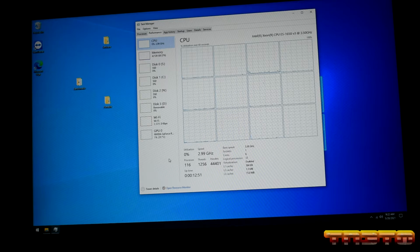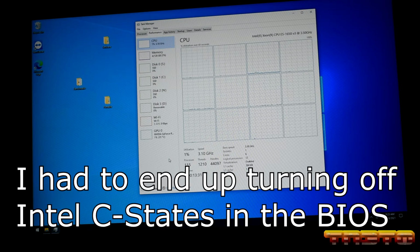Now this is a weird thing, because I went into the power options and set it to maximum performance. When you set power options in Windows to maximum performance, it's supposed to keep the CPU clocked at its base clock the entire time, 100%. Whereas if you have balanced or power saver, it will downclock the CPU when you're not pushing it hard or when it's idle. If we notice right here, our speed is jumping all over the place, even though I have it on maximum performance and the minimum CPU state is set to 100%. So this should stay at 3.5 gigahertz. But as you guys see, even though the computer's sitting idle, it's just moving everywhere. So I don't know if Windows isn't reporting it right. I have to look in HWMonitor, or